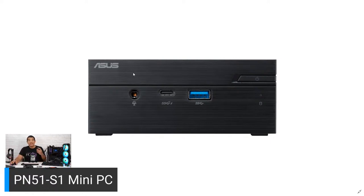So you definitely have quite a bit of processing power, and really good solid connectivity with USB 10 gigabits Type-A, Type-C, and Wi-Fi 6, as well as 2.5 gigabit LAN onboard and support for two storage drives: a 2.5 inch drive or a PCIe NVMe M.2 based SSD.